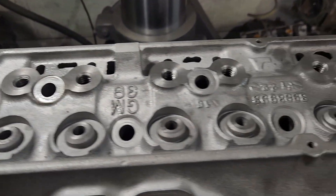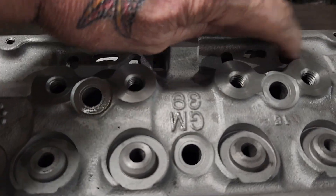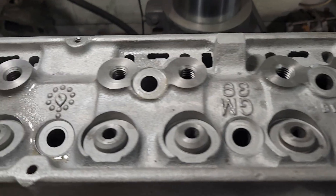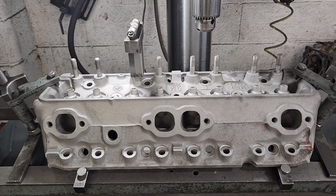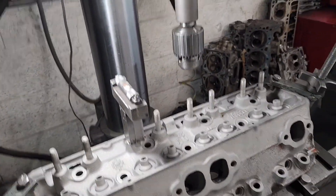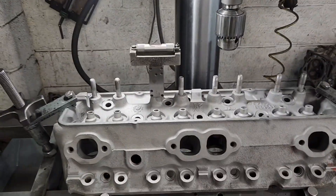They're ready for the studs. I'm not putting guide plates on these — I'm going to let the factory slotted pushrods hold them. It's got a really small cam. If it had a great big cam, we'd put plates on it too. I've got the second head in here and I realized I didn't show you how I level this head. I just used the level I use when I'm putting in guides and seats, but I can't give away all my secrets.